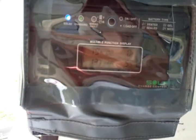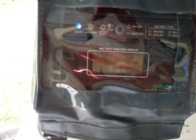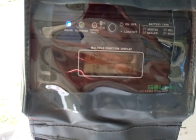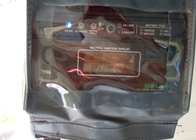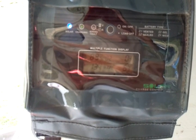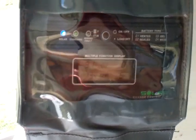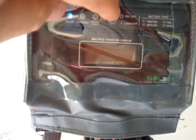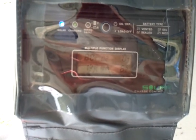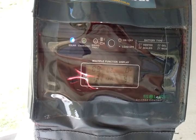The fridge will cycle at about a 50 percent duty cycle. While the fridge is cycled off, at this stage you get 6.2 amps going into the caravan. When the fridge comes on, we lose around about half that in amps powering the fridge.